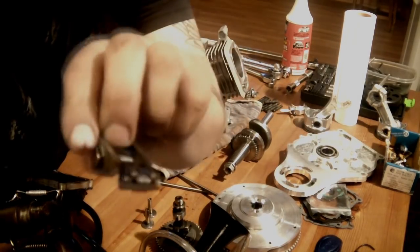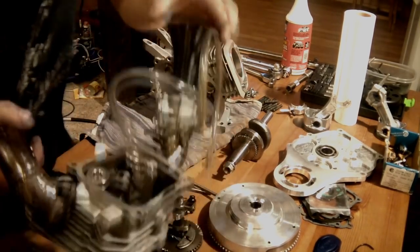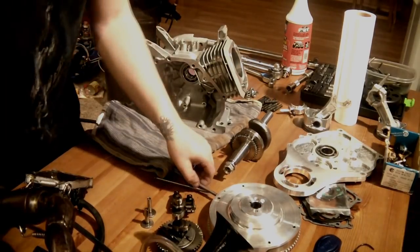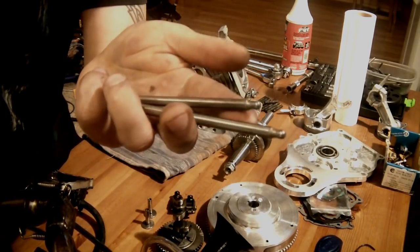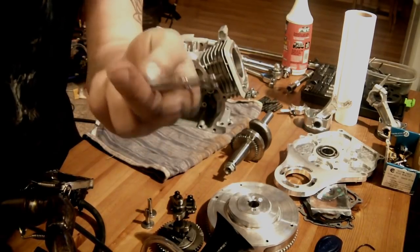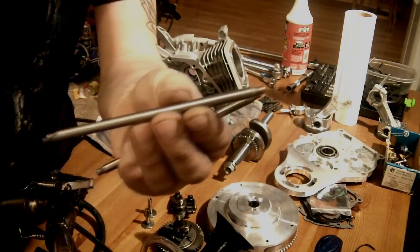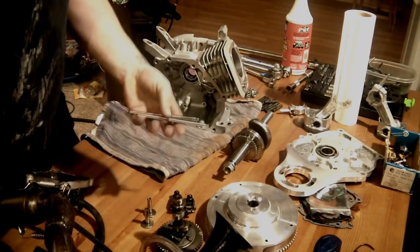I did some heat treatment on the very tips of them. The reason I have those over the stock ones is because in my head I am running 36 pound springs, which is pretty stiff. And to go with those really strong rockers, I use these quarter inch push rods — I think they are designed for a GX390. These are cut to size, so the tips on them are actually a separate piece from the body, and what you do is you cut it to the desired length you need.